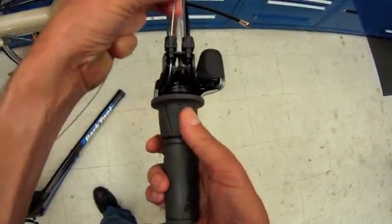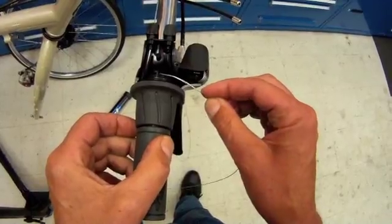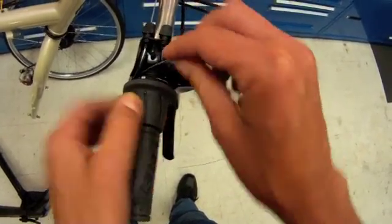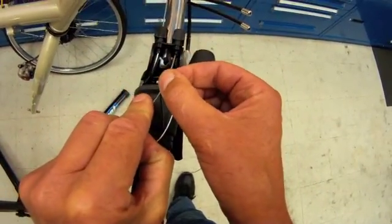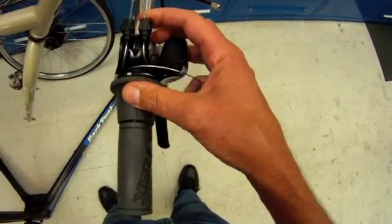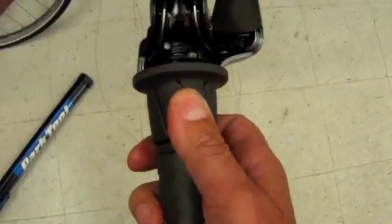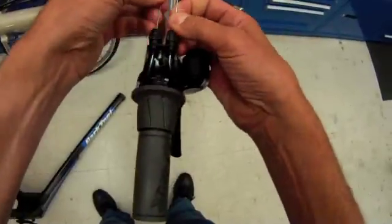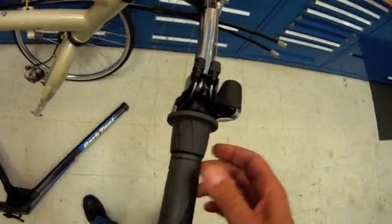The second cable is going to go right through here. Again, a new cable with a gentle little curve to help it along. Feed them together, both going around, and a little push — there it is, coming up through the guide into the barrel adjuster and out. Let's pull this all the way through, rotate, there's the socket, in we go. We now have two cables in our pull-pull system — that is now complete. We have new cables and we're ready to reinstall the plastic cover.